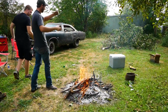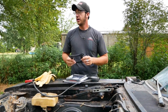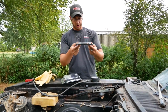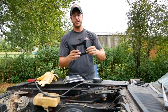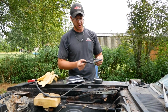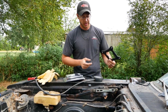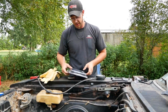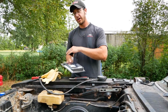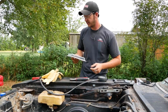Oh, my arm. All right, so while Kevin's going to get the lawnmower and clean up our yard a little bit here, we yesterday went to O'Reilly's and got a new carb spacer, because if you look at that guy, it's kind of bowed, and this was on an engine beforehand, and really these don't work too well if you try and reuse them and they dry out, and you can see it's even kind of split. So that might have been a little bit of our vacuum leak, I'm not sure. We just opted to get another one, so I'm going to get this thrown on here and then get our carburetor bolted on and just keep moving right along. It's looking pretty promising today.